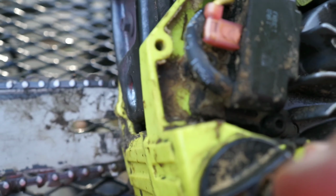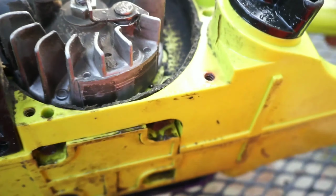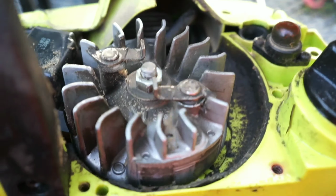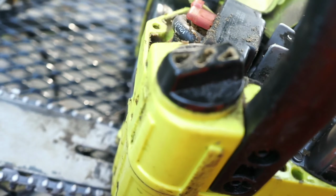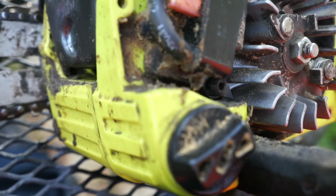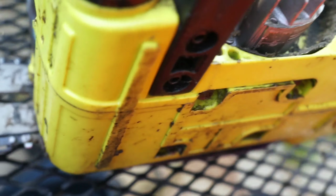And in order to change the coil, we will have to pull the top cover plate off because the primary wire that goes up to the spark plug goes up underneath this top cover plate. When we get ready to change the coil, we'll do that, but in the meantime, we're just here having a look and seeing what kind of coil it is and what it looks like.